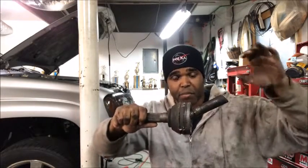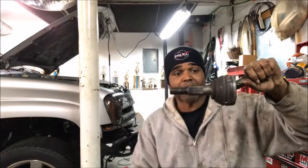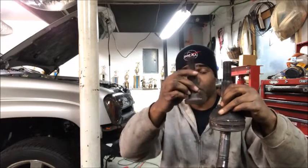When you have a CV joint, the CV joint comes out — this is the part that goes into the front differential, and this piece goes through the hub. You've got this big nut that goes over this and locks the hub down. If you remove the CV joint, you have two options. You can get this little stub shaft that came on rear wheel drive Trailblazer SS — it looks something like this. It's the same as the CV joint on the all wheel drive, but it's a lot smaller. If you go to a junkyard and find a rear wheel drive Trailblazer SS, you'll find this on it — but good luck, because they're hard to come by. If you get one brand new, you're looking at between $130 to $170 dollars, and that's just not a budget build for me.